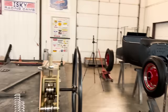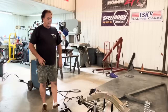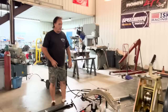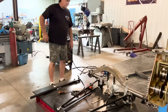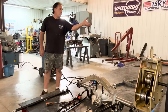The reason I'm having to do all this is just because that car is so small. I can't really just build a frame and stick it up in the car and then make crossmembers to fit it - there's just no room. All this stuff is very tight. But that's basically what Ed had - the crossmember in front of the rear end, which looks kind of goofy but it's the same reason I'm doing it. Shocks are in front of the rear axle, which is kind of goofy, but it's the same. He's doing the same thing I'm doing. There's no way to put these back where it needs to be without the shocks being back under the turtle deck, and I don't want that. History repeats itself - he did it for a reason and I'm having to do it for the same reason. So we're about to tack these brackets on, put the wheels on it, roll it back, set it up on stands, set the body over it at the right height, set the front end under it, and start connecting the dots.